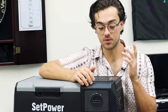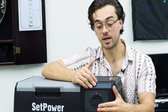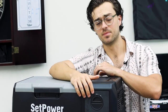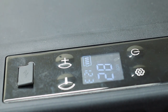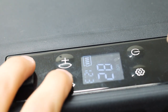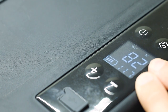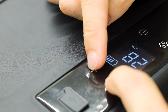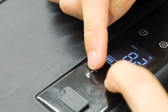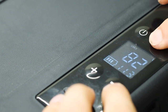The manufacturer says that the battery can last eight hours on eco mode. If the battery is already on and you unplug the unit, it should automatically start powering the fridge and kick onto eco mode. Hold this button to turn on the battery, then hold the power button to turn it on. Hold the settings button to go through the settings. Plus or minus to go from eco to max. Press it again — I'm on three bars and I haven't charged it since the camping trip. Press settings again — this changes the battery protection level. You can put it on high, medium, or low. Then it can change between Fahrenheit and Celsius. I'm in America, so I choose Fahrenheit.